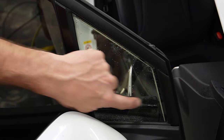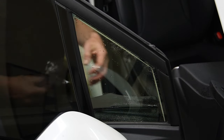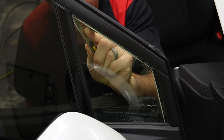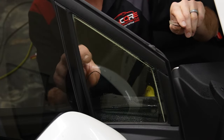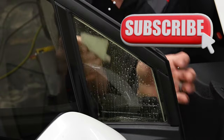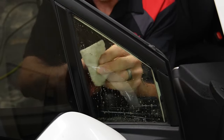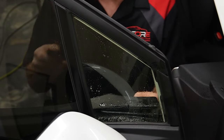Let's go ahead and get this window cleaned and then we'll put a piece of tint in there. These are going to take a lot of practice — if you're new to tiny windows, expect these to be a disaster. Even as a long-time installer, I run into issues on these windows and I'll live with a little bit more contamination and damage to the material while tucking it in. I'm going to go ahead and trim a little bit of this rubber just to make sure we have a slightly easier install. That's a tiny amount — nobody's ever going to notice that, and it will definitely help the install. Let's get that all wet and get a scrubby pad way back in there — just really get as much scrubbing back in there as you can. Now we're going to razor blade this one still.